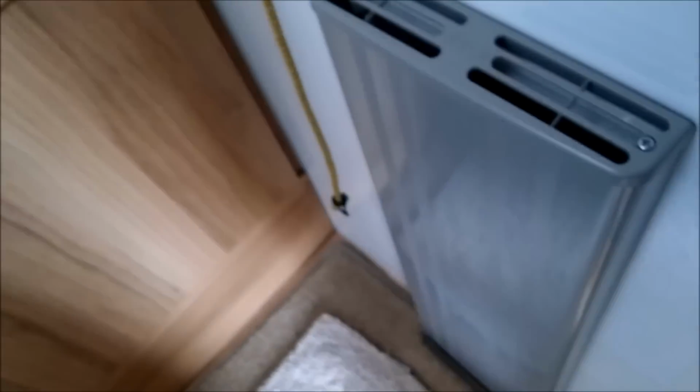We're back down at the boiler end now, where we shall leave the pump on high for a second. Let's have a look at the bleed valve on there. There we go, and just see if there's any air in that one. No air at all. Bit of a gurgling still. Leave a towel under there just to catch any surplus.